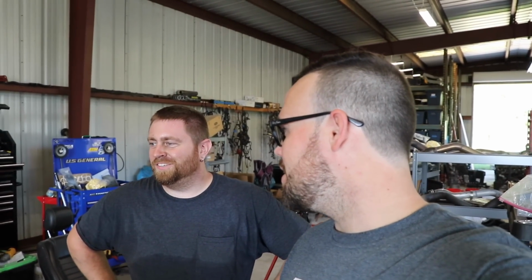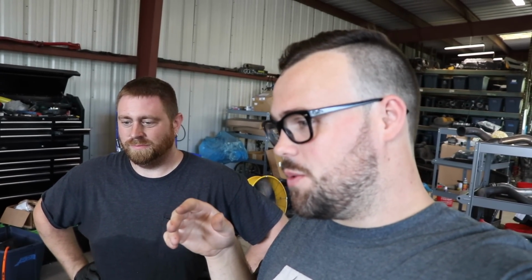Brad, you want to talk about how fun that was? Scale of 1 to 10, let's see. Probably 3/4. So, I don't know if it's really the 3-valve or just the fact that these are eBay headers. I think a lot of it has to do with that they're eBay headers meant for a 2-valve, so they're very tight. So the heads are different position, obviously, and then there's also little spacers, so it's moving them outwards. It's in there. So yeah, had to clearance the headers and do a bunch of fun stuff, but the engine itself fits in here pretty well.